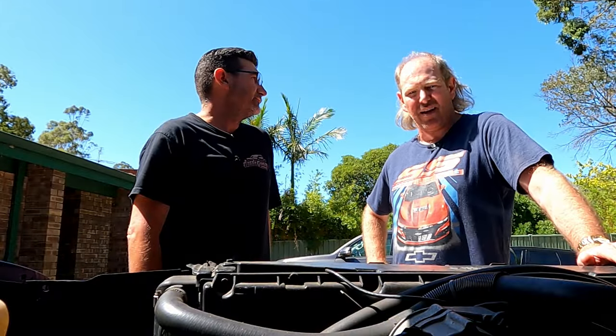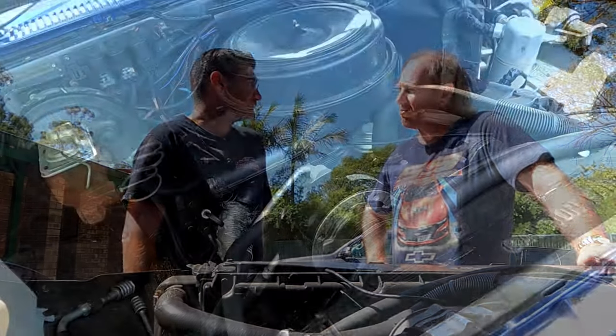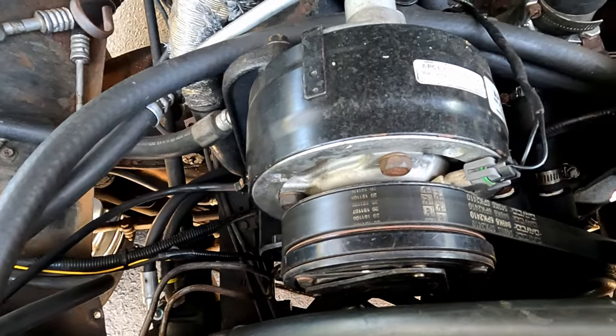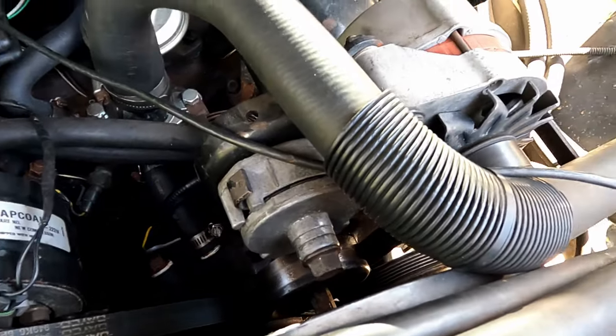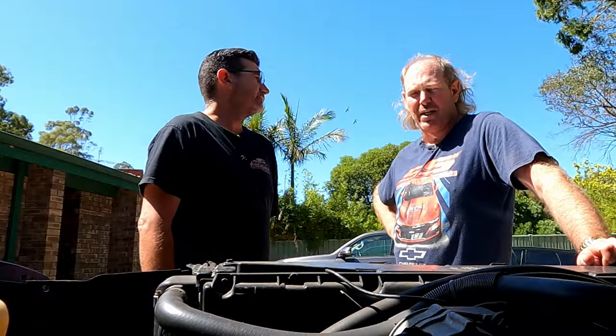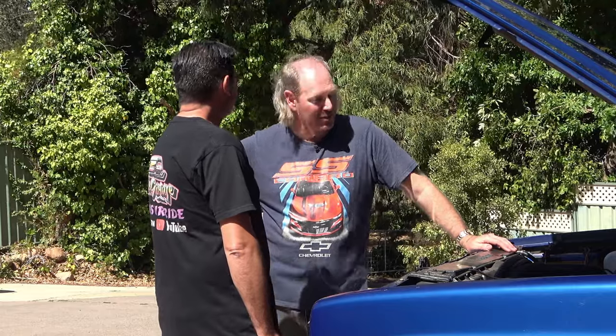These engines at that late 80s period — it was a pretty crappy time with American V8s. They're heavily smogged down and didn't make much grunt for the size of the engine. But it's got reasonable low-down torque and basically it's pretty close to a diesel the way it runs. Haven't rebuilt it or freshened it up — you've just maintained it? Pretty much. I'd like to give it a tickle at some point, but these are a low-compression engine, so it would really need all new pistons, bump the compression up, new cam, definitely new heads. The old peanut port heads on it are pretty restrictive and don't flow very well.